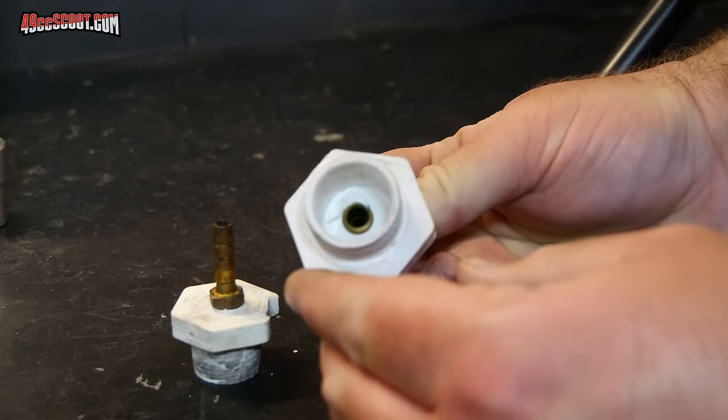That's what my test rig looks like, but yours doesn't have to be like mine. You can make it however works for you. The important part is just to be creative and come up with something that will work for your engine. This is also part of a brake bleeding kit — mine is a vacuum pump but they make ones that do vacuum and pressure too, so you could use something like this. Some people actually use vacuum to look for leaks, though I prefer pressure. Some people also set up a Schrader valve — the same as your tire valve stem — and hook up a bicycle pump. Others use an air compressor with a Schrader valve, but make sure you regulate pressure way down low to an appropriate value; you don't want to pump in 50 psi and blow the seals out.